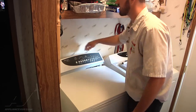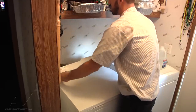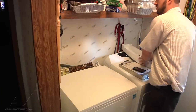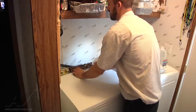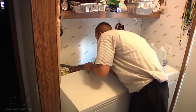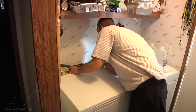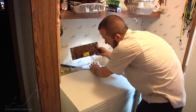What we did was take the two screws out on the back of the control panel, and basically this just kind of lifts forward like that. We disconnected the cable that hooks into the main board and pretty much just went through and disconnected every harness to the board just to get the board sitting by itself. We've got one small little tab down in the base here that we're going to just depress. Every connector is disconnected from the board, and we're going to go ahead and pull that away.